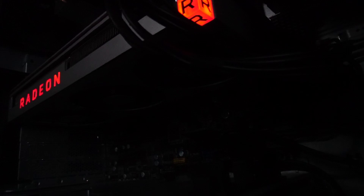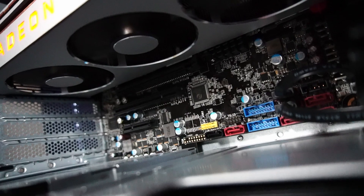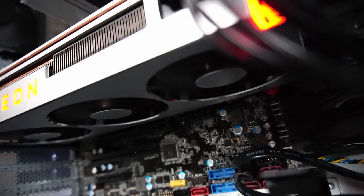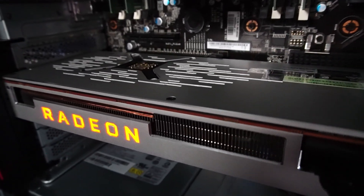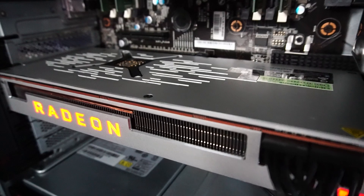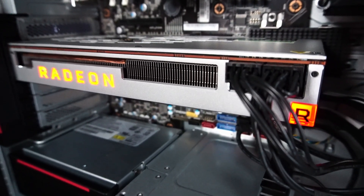To get a really good look at the red highlights, I've got to turn the lights down pretty low, but we can see there's a cool kind of three-dimensional R on the end, and the Radeon logo is illuminated quite nicely. This is a fairly well put together, industrial looking GPU with three fans and a beefy heatsink with a unique design where the fans are kind of built into the heatsink. I'm not going to get into the heavy details of the difference between HBM2 and GDDR6 graphics. Let's just say that GDDR6 and GDDR6X will be greatly better for gaming, and for different workstation uses, the HBM2 memory offered by the Radeon 7 might have its advantages.